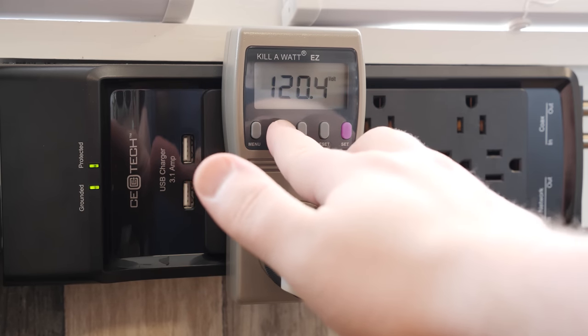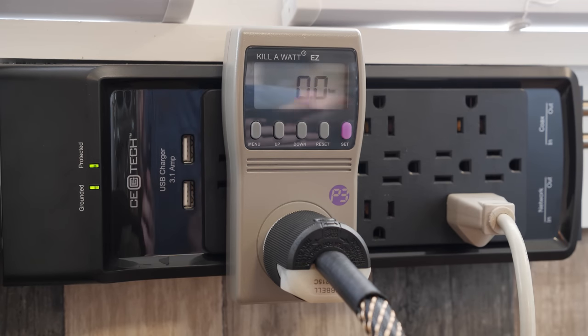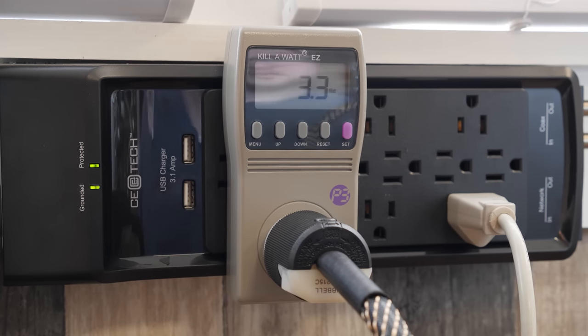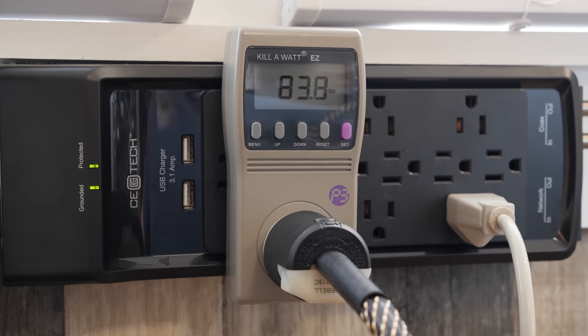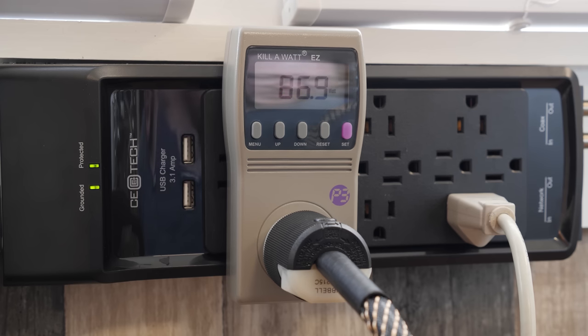So I'll take the computer's power and plug it into the Kill-A-Watt, then plug that into the wall, and this will tell us what kind of power is being drawn from the power supply as we do various things with the Thermaltake X-Ray while the computer is running. Right now we can see it's on 120 volts, 60 hertz. Plugging in the power supply of the computer — computer not turned on yet — and you can see it's already drawing just a little bit, because that's what computers do. Powering on the PC, we're getting between 85 and 90 watts just at startup. Nothing crazy. The power supply installed is a 300-watt AOpen unit from around 2000 or 2001.